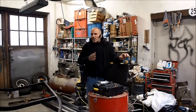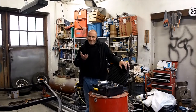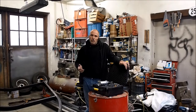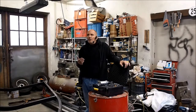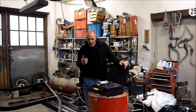You do your first coat, you let it dry till it's not really sticky anymore. So usually, if it's 20 degrees in the workshop, it should be around 15 to 20 minutes. And then you put on the second coat, the third coat, as much as you need to reach coverage. I usually do not more than three layers, because then, again, you build up far too much material. And if you have enough flakes in your binder, you should reach coverage usually after two layers.